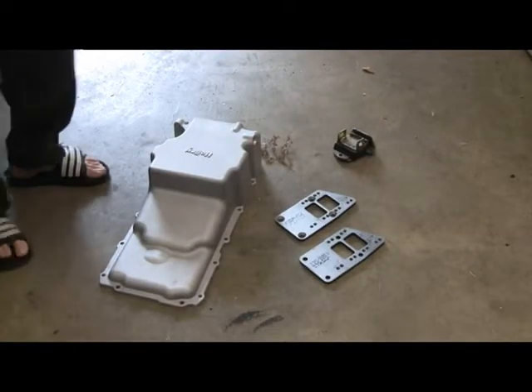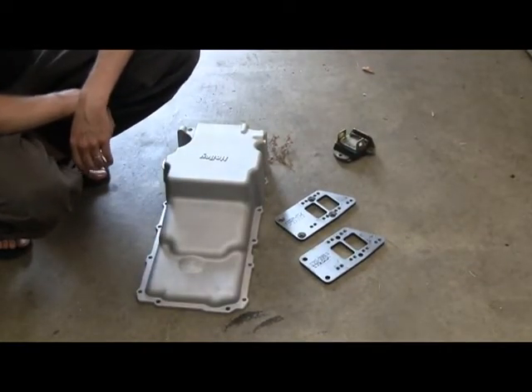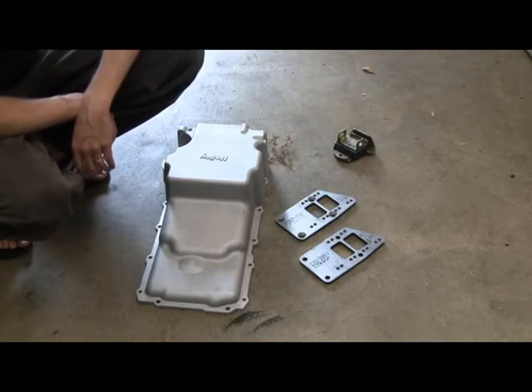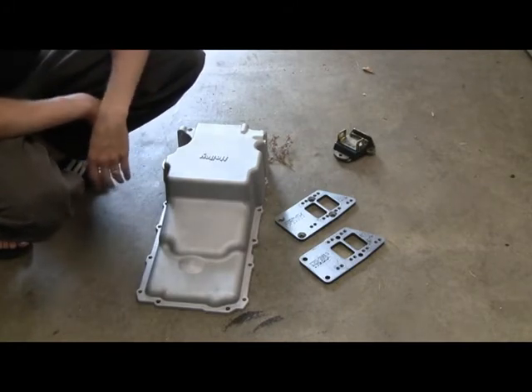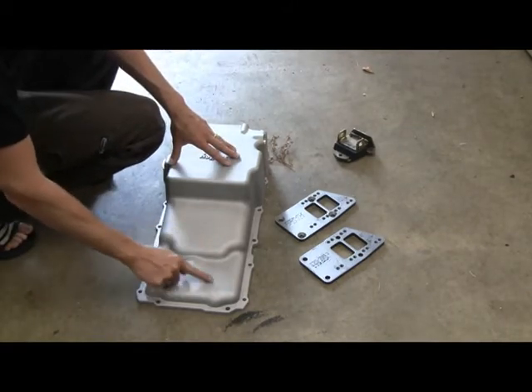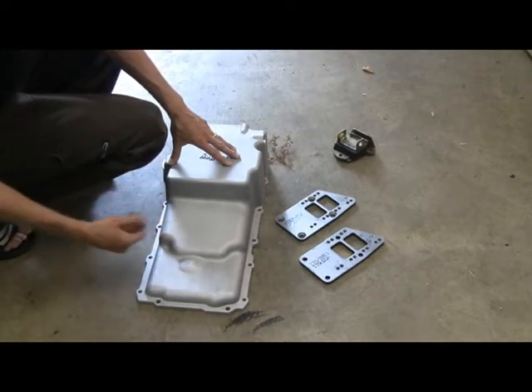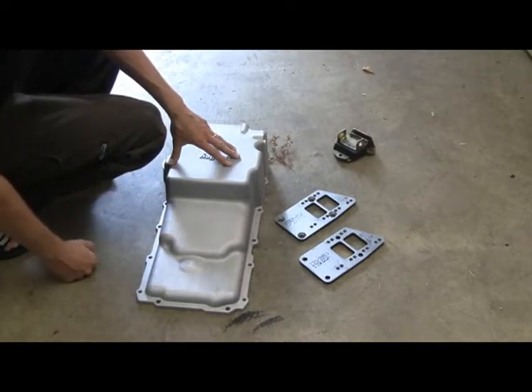So what I want to do is lower the front of the engine — simple as that. I'll show you what I bought to try to do that. I bought a new oil pan; it's a Holley. It's unfortunately twice as expensive as the GM muscle car pan — like $350. But what it does is it's got this cut down in the front for it to clear the crossmember, so I can drop the motor down farther.